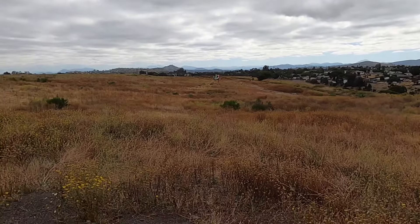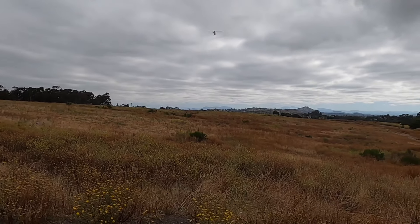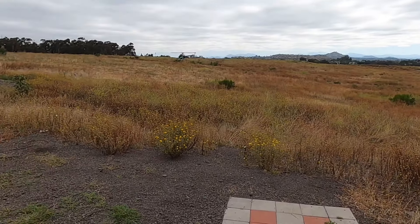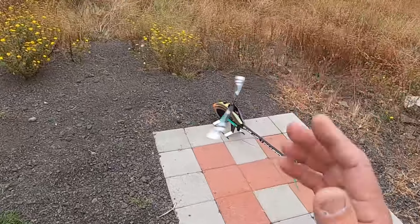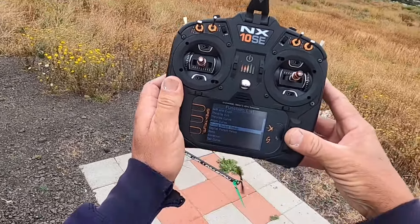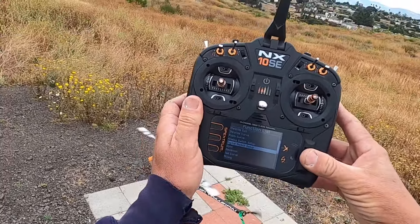A little too much tail gain. So let's learn something else - we saw it just went into some little convulsing on the tail. The gain's a little too high; I was messing with the gain yesterday. In basically any flybarless system - this is the ICON - we're going to go down here to gyro and turn that 57 percent down to 54.